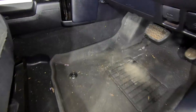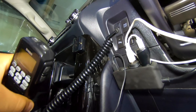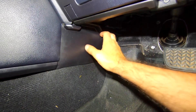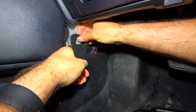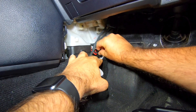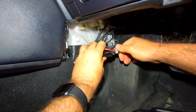My CB sits behind here and I have a mic that just comes out of the dash there, with the speaker and everything in the mic. I also have a speaker here, so it just sits in here behind this panel. You can just pop this panel off at the back - just a couple of little pop-off clips - pull it up, get it over that tab, and pull it out. Just making sure the wires don't get caught. We need to get to this connector here because that's what we're going to test with.